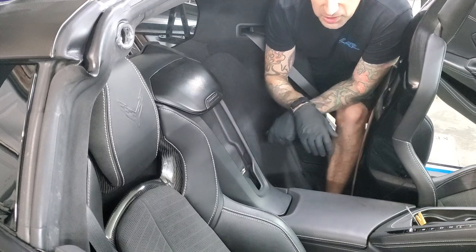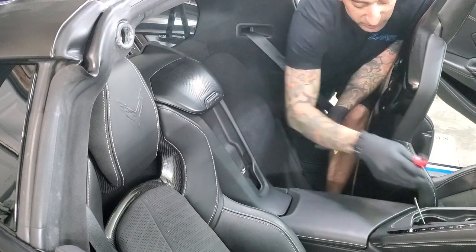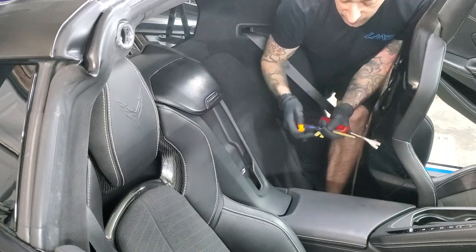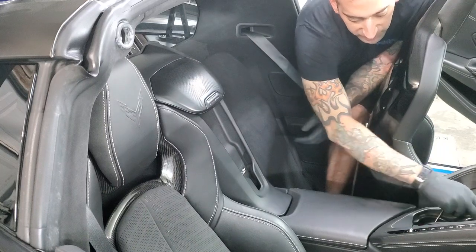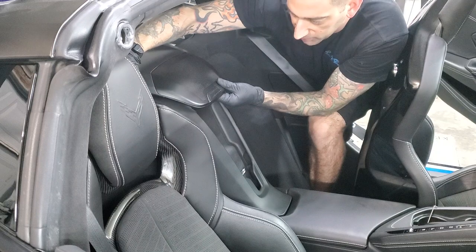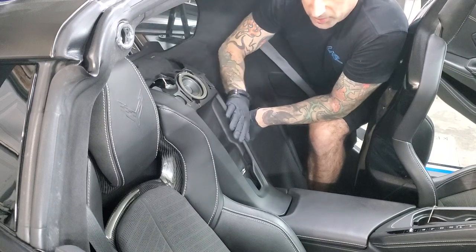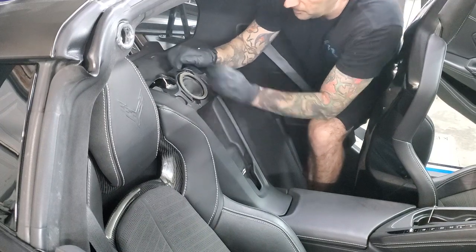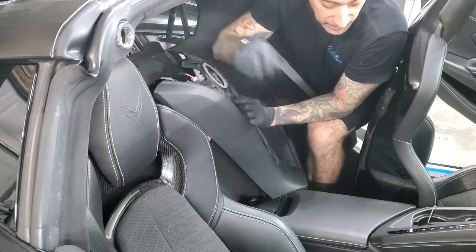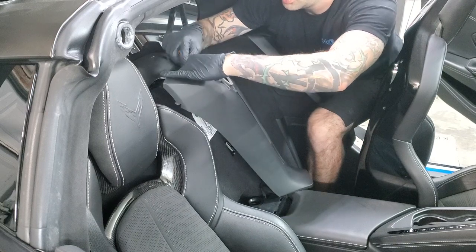The first thing I'm going to do is pop out this center waterfall on the center speaker here. As far as tools you're going to need: a plastic trim piece tool, a panel popper if you have it, and I always like to keep a right-angle pick and a small flathead screwdriver handy. These come out really easily — it's just these four clips, just pull up on them and they come right out. Mine is going to come out a lot easier because I've taken them apart a bunch of times. On this I'm going to disconnect the top speaker and take that one out.